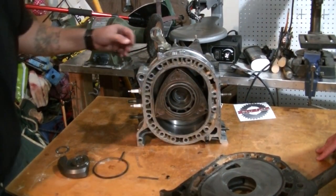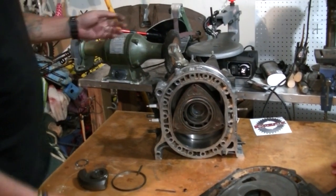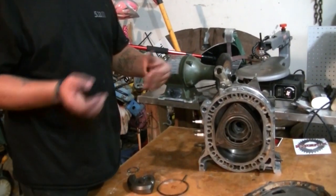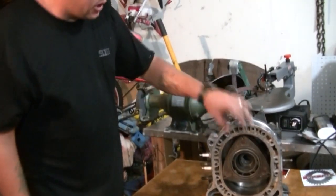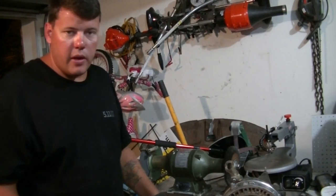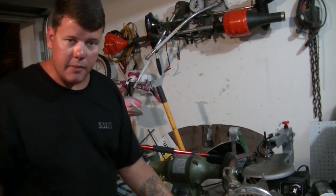So putting fuel in, even on a carbureted motor, you can simply pump the gas pedal. You pump gas into the chamber. That's also taking oil and lubrication. You put oil lubrication into it upon startup. You have a clean startup with a lot less apex seal wear.